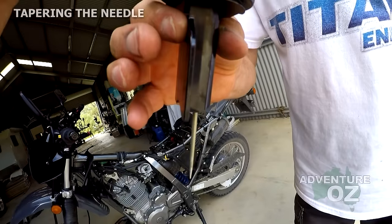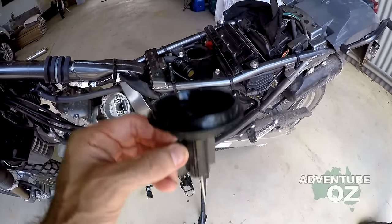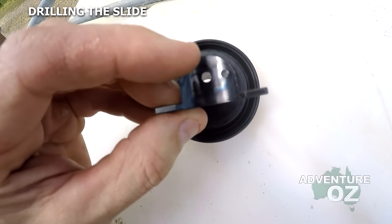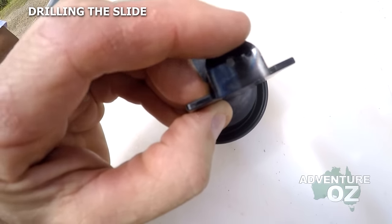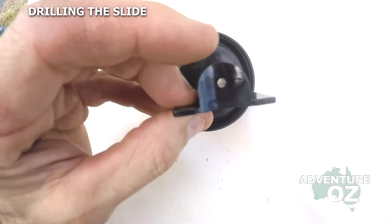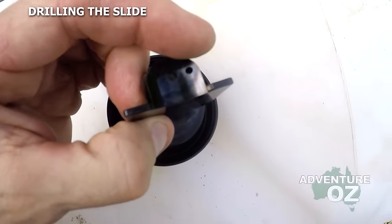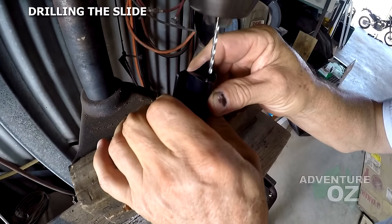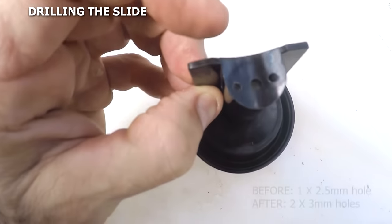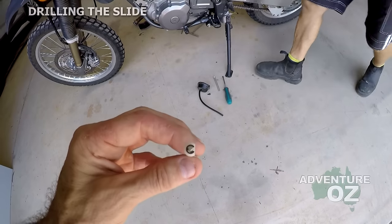You really want to look after this diaphragm. If you get a little nick in it, the bike is not going to operate properly — the slide won't have a vacuum to work against and your throttle will pretty much stop working. Once the engine's running, the vacuum created is what determines how quickly the slide comes up. We actually drill an extra hole here so we'll get better throttle response — the quicker the slide comes up, the quicker the fuel comes in, which is very similar to what a pumper carb does. We also drill out a second hole: drilled in from the side first, then straight down. So we had just one 2.5mm hole and now we have two 3mm holes.